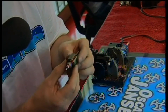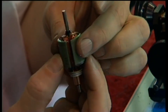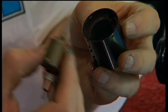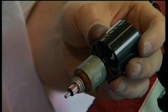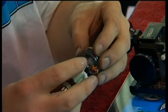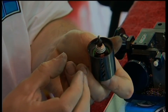Check if the armature is still in good condition — is the commutator nicely cut, are the wires still okay, is everything fitted? There's nothing strange to detect. You do the same with the motor inside — did it pick up some metals, how does it look? Check for the bearing. This one is fine. Check this one too — it runs great. Always check if there are no shims inside. Click it in. It's easy.